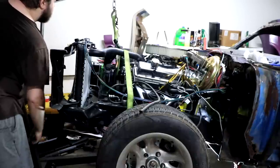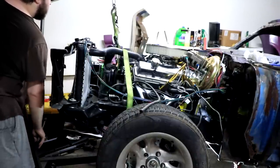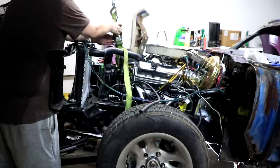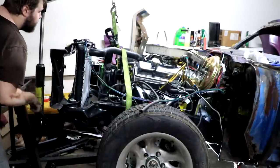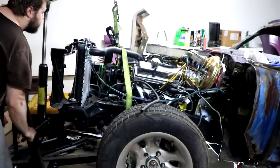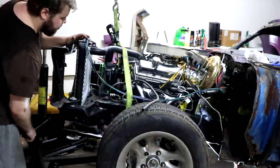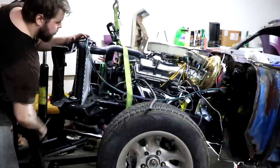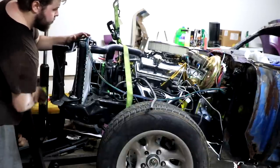After failing for about an hour and a half going into two hours, I decided to try lifting the engine up just a little bit, and hopefully that would give me enough clearance to fit the oil pan gasket through. I lifted it just enough to give myself more clearance, but not high enough to warrant taking anything off, adjusting the motor mounts, or worst case, breaking something. It was just a couple extra inches to let me feed the gasket through, and this actually worked.